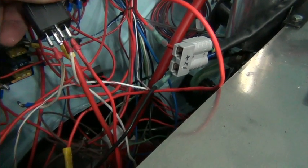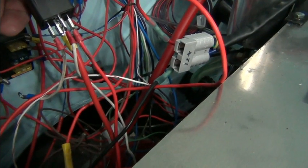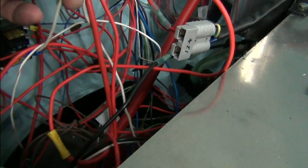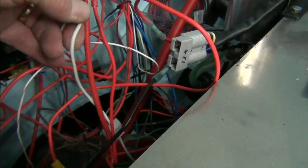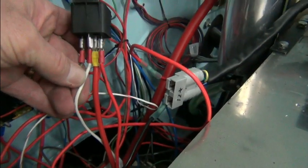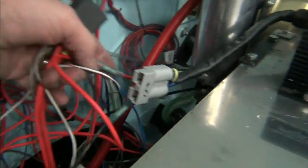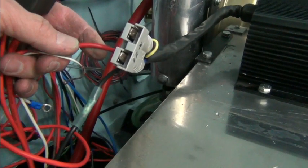Okay, your circuit needs to all be consistent, and it needs to match the load. I'll tell you right now, this little wire right here, I don't know if that's 14, might be 16 gauge. That feels like a 16 maybe. This is not, look at the size of the wire that's going in. That should be consistent throughout.